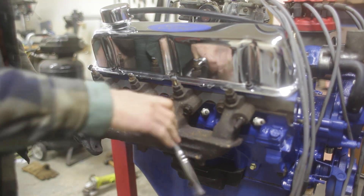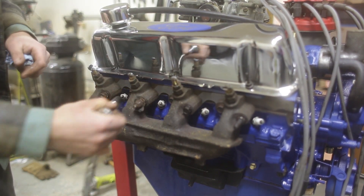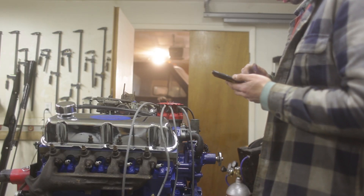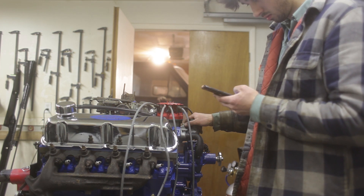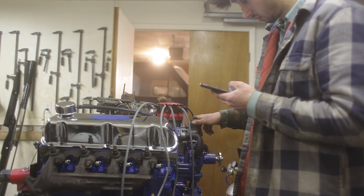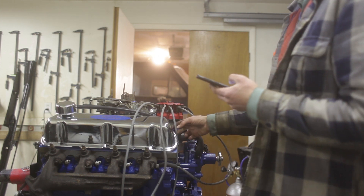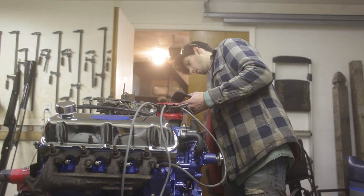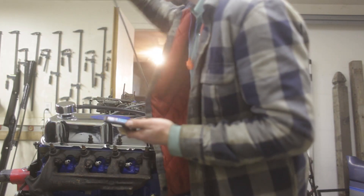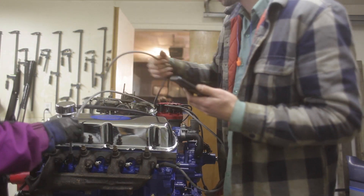V8s are just so much work. Instagram really liked my picture with the air cleaner up on top of the carb and the engine kind of together - I wonder if they'll like my picture of my welds. We looked up the firing order on the internet - love you internet - so we need 1, 5, 4, 2, 6, 3, 7, 8. So that's the sequence - 4 is this layer and then this one is 2.